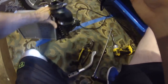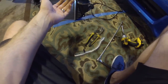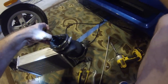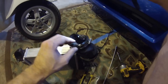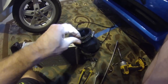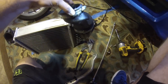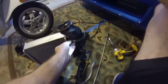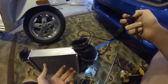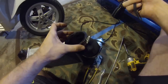It's covered in oil. What I'm going to do is clean that up and see if I can get this resealed. I've heard from some guys on forums about possibly doing hairspray — reminds me of putting handlebar grips on a bicycle. I just kind of tucked it all back in and it looks like it has an extra little seal. It came out of there with no effort whatsoever. I'm going to inspect this more — I'm probably going to get a Mishimoto silicone throttle body to intercooler hose. I've heard these are notorious for having this issue.